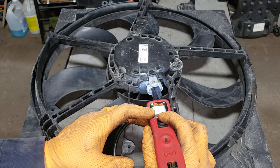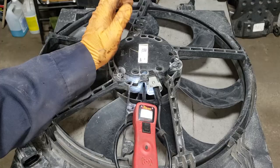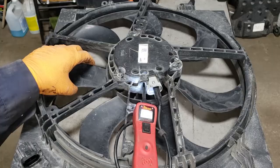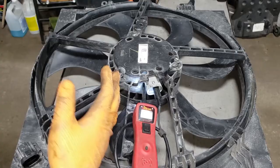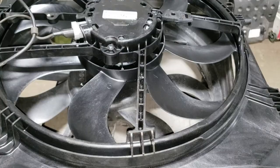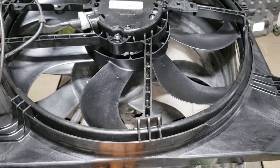With any motor, if you have one side connected to either 12 volts or ground you'll have that same signal on the other side. My power probe lights up confirming a good circuit. Now to test it we fire the positive side — and nothing happens. That tells me this thing is dead, and it's probably over-engineered with some bullshit component inside used as a fan controller. I might take this apart later to see what the deal is — hopefully just a regular motor and not some stupid little circuit board with a microchip that serves no real purpose.